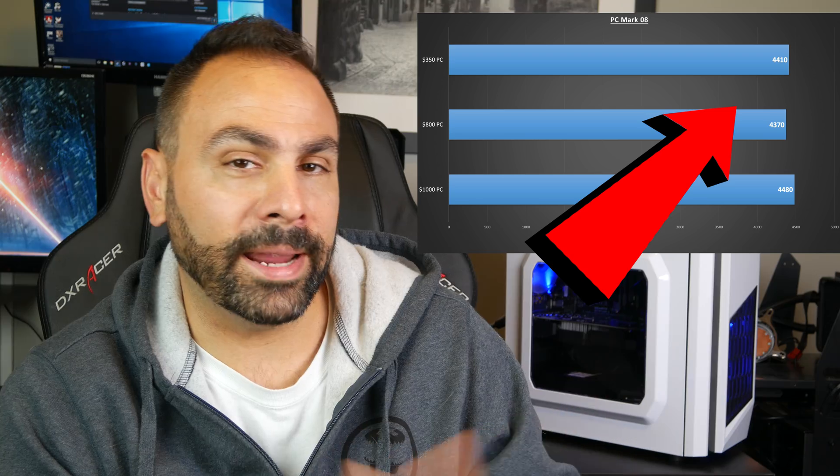There were a few quirky things that happened while I was doing the benchmarks. The PCMark score actually exceeded the score we got for an $800 system, which is likely because PCMark scores are very even across a lot of systems — it's a very basic test of productivity, word processing, things of that nature, so you're not going to get a huge variation. One thing I did want to comment on is load times. It takes a little bit longer to load some programs since the processor is only two cores with no hyperthreading and we're dealing with a hard drive instead of an SSD. But the programs load fine, and once they're loaded, they run pretty well.